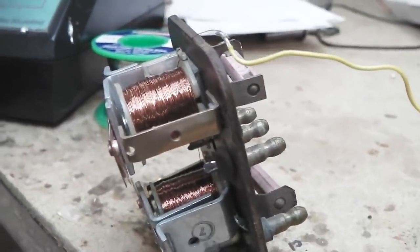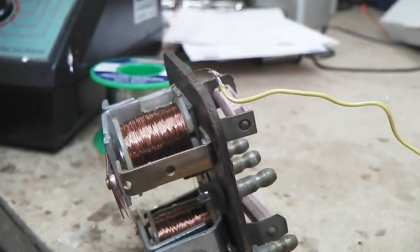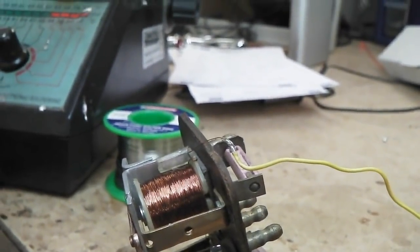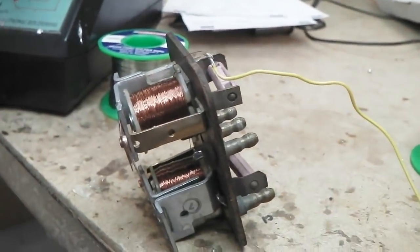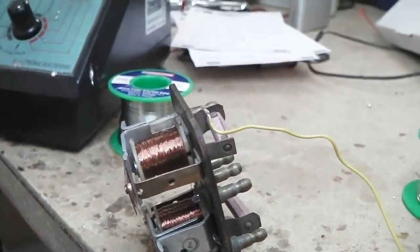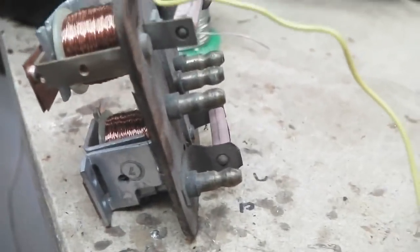Right, I'm just working on getting the headlights and all the switches working in the loom. First I found the headlight switch itself all corroded up and not working. I'm going to take that apart and clean it. I'll show that in a minute. This might help you if you've got a Cortina, because often the headlight switches fail. They either corrode up or they just don't work. Well, mainly because they do corrode up.